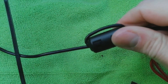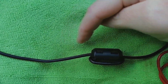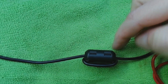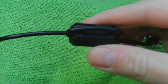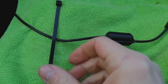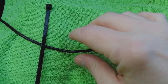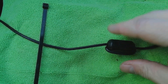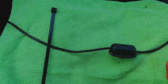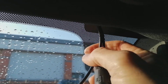There's your ferrite filter fitted. The clips lock on the hinge on the back — you basically open it, loop the cable through the middle, around the back of it again, and then snap it shut. Now I'm going to pop a cable tie or two on the cable so it bulks it up a bit to stop it dropping down from the top of the headlining. You don't want to be driving along and suddenly have the cable drop down in front of the passenger. So wrap it, snip it off, and tuck it up above the headlining.